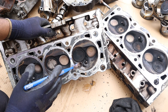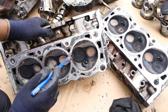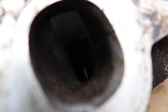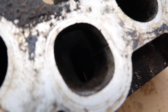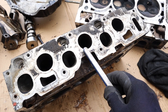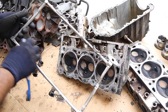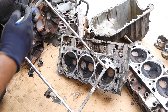These engines don't make that much power — they're very old school in design. You can see this is the intake and that's the exhaust valve, and there's only two valves per cylinder. A lot of modern engines are going for four or five valves per cylinder. You'd be lucky to hit 190 stock horsepower with this. Now because of Ford's variable intake system you do have two runners per cylinder, and you'll notice that one of them is really clean while the other one is really dirty. You have the port injection only going into one runner whereas the other one remains dirty. The back of the valves look pretty clean so that's okay, but that's not really ideal for airflow. The SPI system is turning on and off one set of these valves, which means that when your EGR kicks in it's just going to come up to one side as opposed to the other. Now speaking about the injectors, this fuel rail design is kind of weird — they have a flex hose in the front and a flex hose in the back, kind of like an H-shaped design so it sort of balances out the pressure, whereas most systems will just have a U-shaped design without this cross pipe.